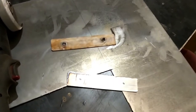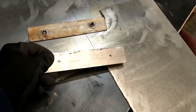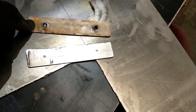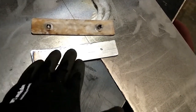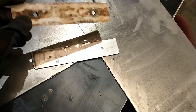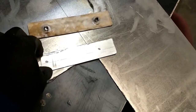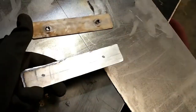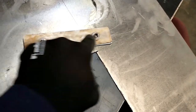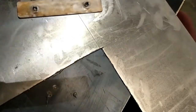To make the new backing plate, I started with a piece of plain old mild steel, 16 or 18 gauge — nothing too special. This piece of plastic basically buffers the metal from the glass in the original configuration. It came out and it's dirty, but it's not damaged because it's plastic. I'll use that to size out the new plate. I've marked where I'm going to put my studs through, and that way I'll have a brand new backing plate to sit on.